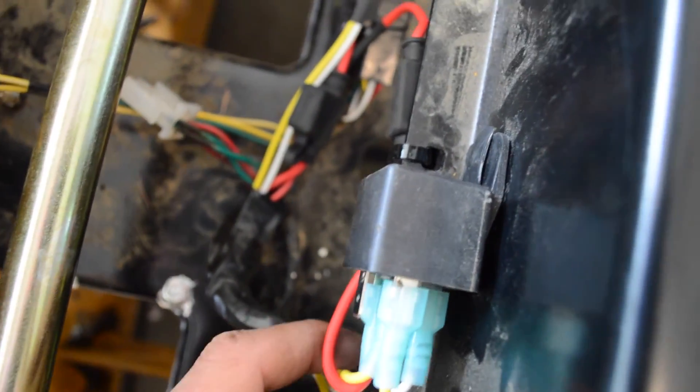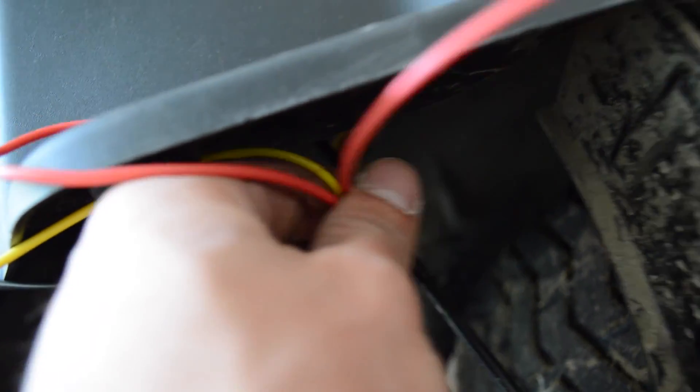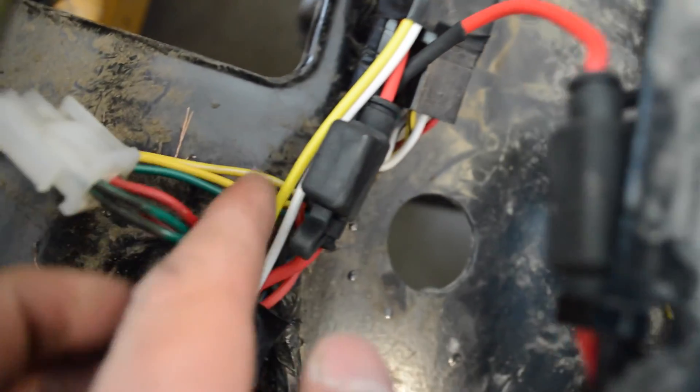You can see right there where my new positive wire is, coming in and powering my new accessories. I have my relay switch all hooked up and wired. Everything is kind of combined into the existing wire harness. This black and white wire goes into this harness and then I added conduit and it goes in the frame rails and then we'll connect to the front light. These wires will power my accessories up on the little dash right there. You can see I have a fuse right here and a fuse right here - they're both 15-amp fuses. I also added a ground wire right to the engine block.